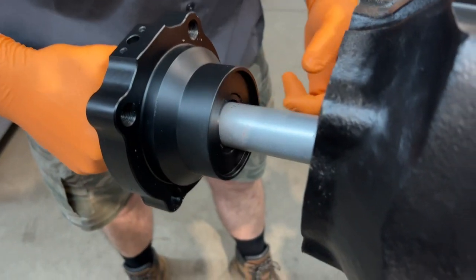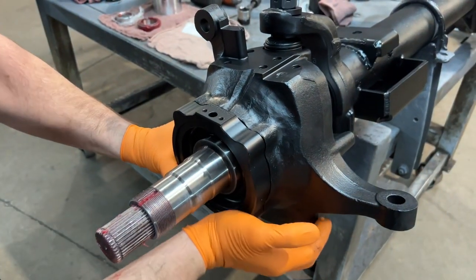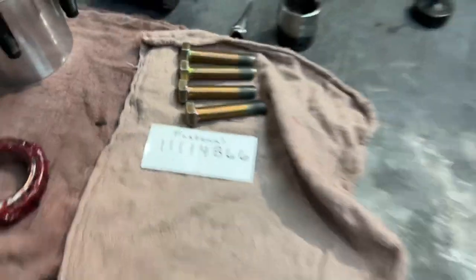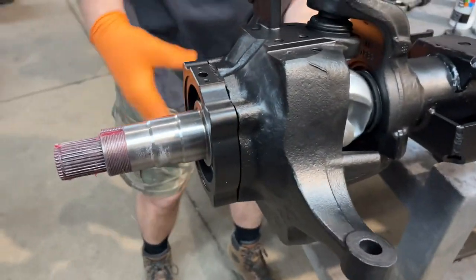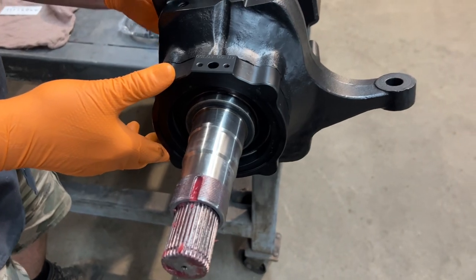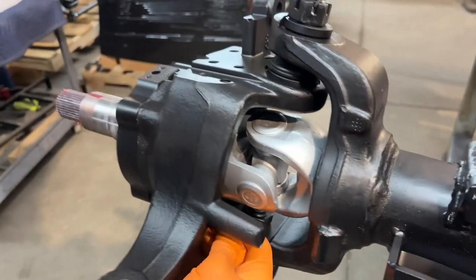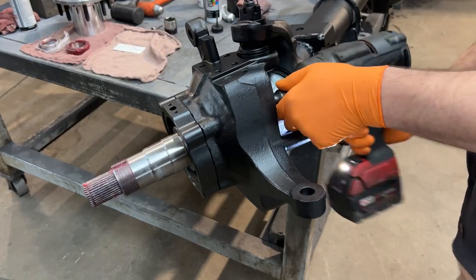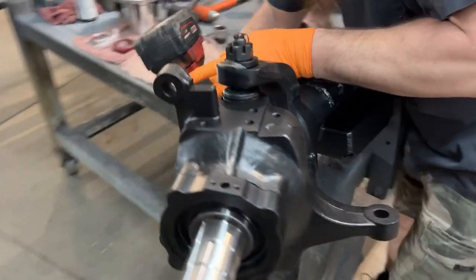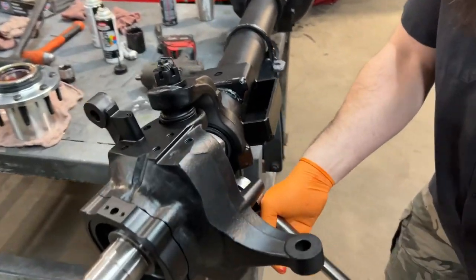The seal still gets pressed in on the back side of the spindle before you slide it all the way on. We use grade 8 bolts that we get from Fastenal — there's the part number if you want to get them. These spindles are set up to use the stock unit-bearing mounting studs, so you have an option: you can use those, or you can get new bolts. We like the fresh bolts — they just screw in from the back side, just like a unit-bearing would. Now we're going to torque those to 150 foot-pounds.